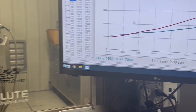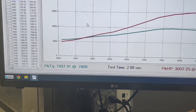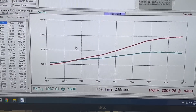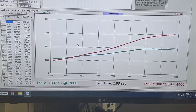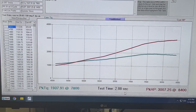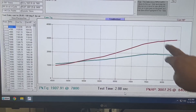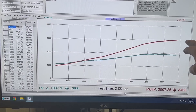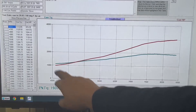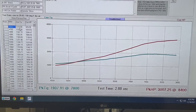All right, let's take a look at the numbers. Pretty good piece, obviously. Nice — top dragster, top sportsman, big block Ford. Sorry about that darn monitor pulsing; it doesn't pulse in real life obviously, but it does when it records. Someday I'll figure that out, so I apologize for that. I can see right here: 3,007 horsepower at 8,400 RPM — it's just starting to roll over right here, pretty much done right up there. It's making good boost right here. You can see 1,937 foot-pounds of torque at 7,800. All the way down here at 4,500-4,600 RPM it's 1,110 in torque, 978 horsepower. Really nice stout piece — 136 methanol, new big block Ford billet intake manifold, only available here, with two sets of injectors in it.